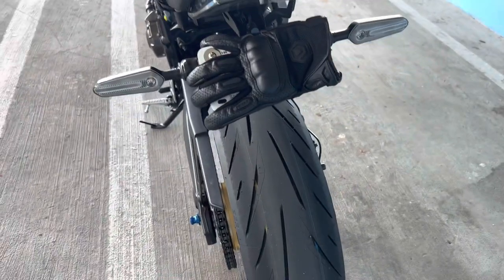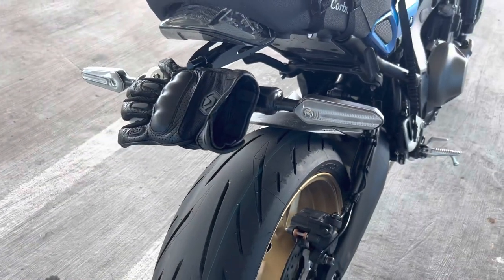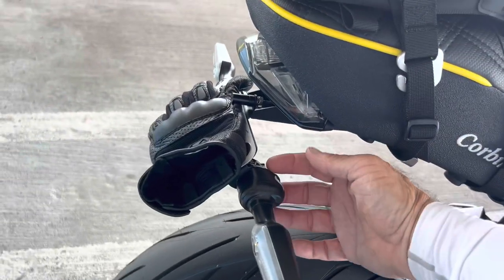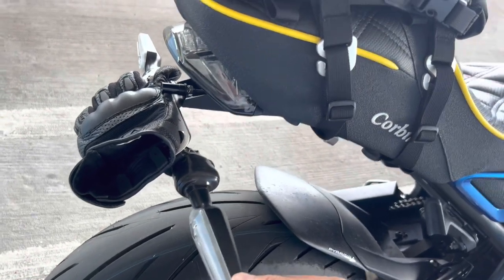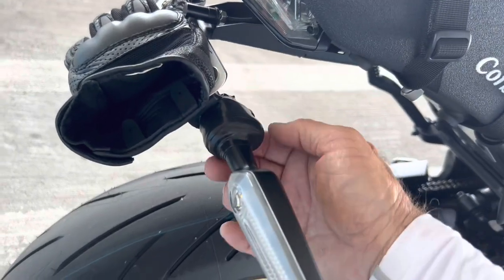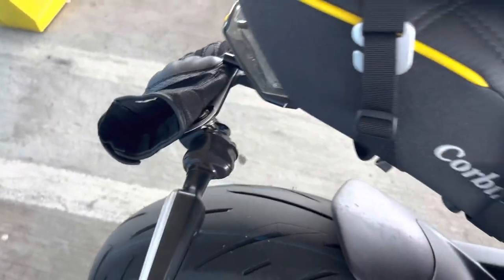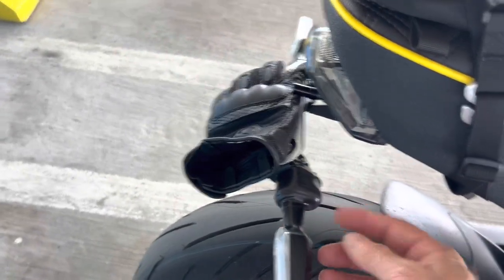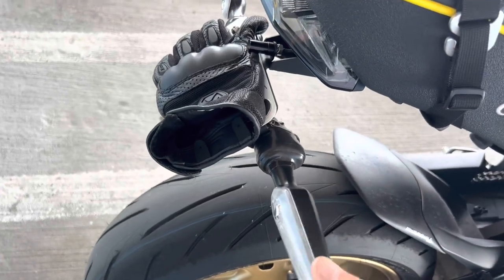Back here, this is a Brogue Motorcycles tail tidy — pretty easy to install and I like it a lot. I do like the OEM LED turn signals. One modification I made to the Brogue setup: they provide plastic clips that go behind the metal frame. It's a little tricky to get them installed, and even installed properly I found it was kind of weak — they drooped a little and were fairly easily dislodged. To fix that, I got some self-amalgamating tape — also known as self-fusing tape — from Walmart or Amazon, about eight bucks for a one-inch by ten-foot roll. That tape fuses to itself when you stretch it and press it against itself. I basically took a roughly 14-inch section and did a cross pattern with a couple of wraps each. Now it's quite secure but still flexible, so it can be bumped without snapping off.